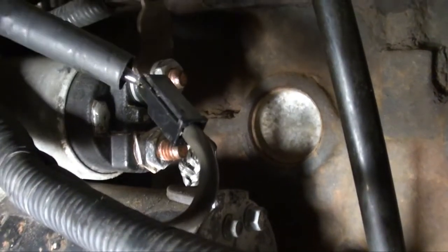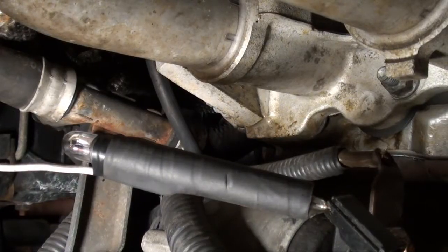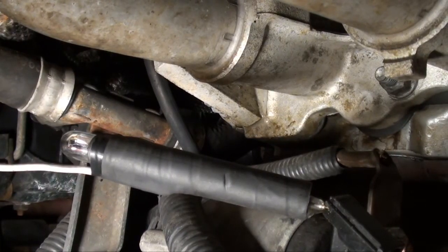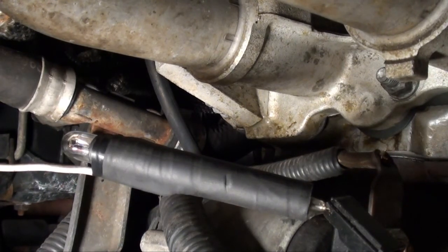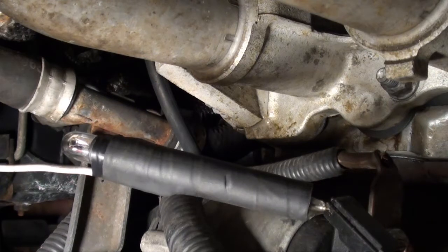When I push in the clutch and turn the key to start, that light bulb should light if this circuit is complete. Okay, you guys watch it. I'm going to go try it. Okay, ready? Key's on. Clutch is pushed in. Start. Do I have anything? There it is one more time. Start. Is there anything out there?